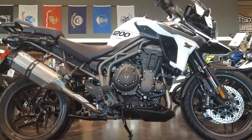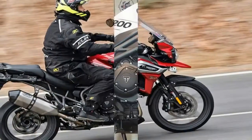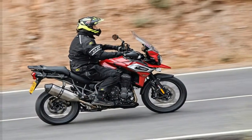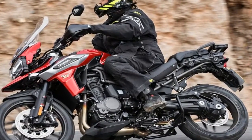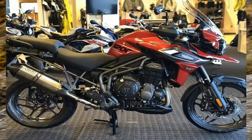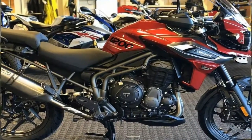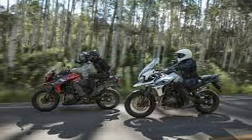The support system is no great mystery on this machine, as the tubular steel trellis is plainly visible — the factory wasted nothing on superficial body coverings and left it all hanging out for the world to see. Since the structure uses the engine as a stressed member to replace a whole section of the frame, it's left with a steering head set at 23.2 degrees, a couple of spars, and a hard point for the single-sided swingarm as the main structure.